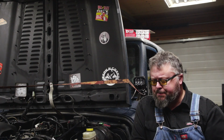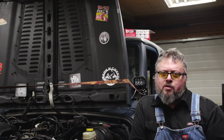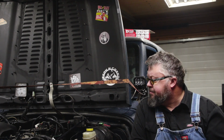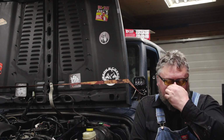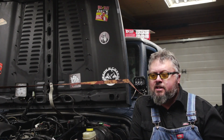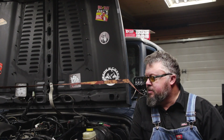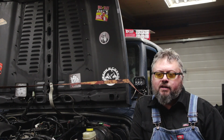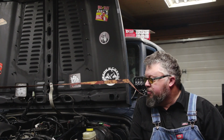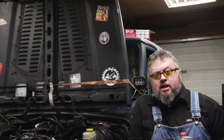Oh, excuse me. I don't know how much longer you could go besides the lines that they give you, because obviously over a length of time you're going to have a pressure drop, and you really don't want a pressure drop in your motor too much. So that's taken care of. Still lots of little things to work out. Once everything's together, I need to put some oil in the transmission. I haven't put spark plugs in or anything like that, so I want to crank the engine over after I get oil in it. This is hooked up, and just get that oil pump pumping, because I don't want to fire up the engine with it dry. It was already pre-lubed when I bought it, but that's almost a year ago, so I definitely want to crank it over without spark plugs and get it ready for the test start. Still waiting on some more parts, but anyways, enough rambling on.